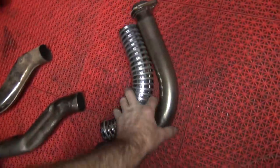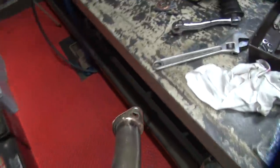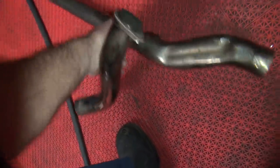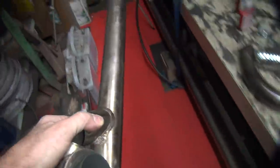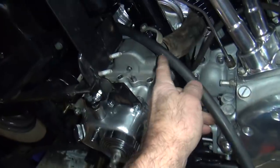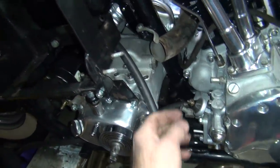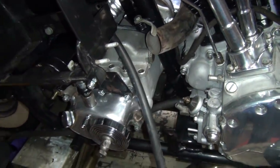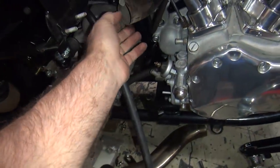Okay, obviously this is going over here. I've cleared my table off and arranged my tools so I can get to them — you can't find your tools because it's a mess, straighten up your mess. We have to figure out what the exhaust is before we do our oil lines, because we want the oil lines NOT going right through the exhaust pipe — that would be a bad problem. Right off the bat you can see where this oil line is at and where this exhaust is at. It's blowing right into the system where we don't want it.